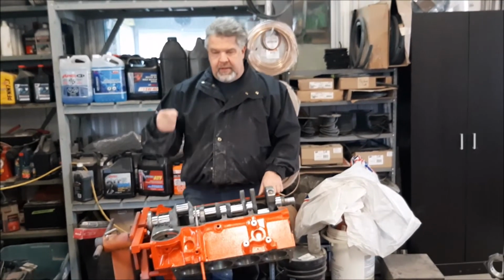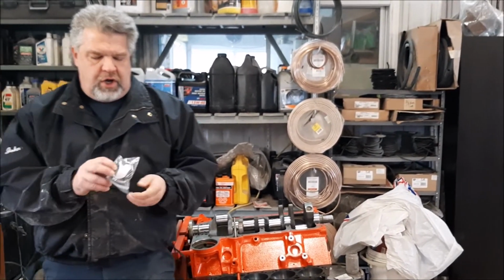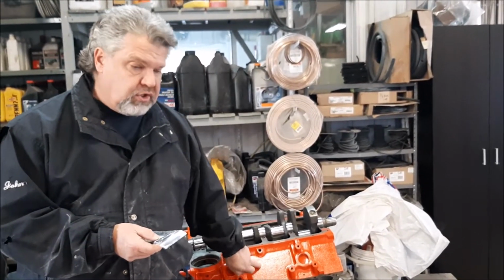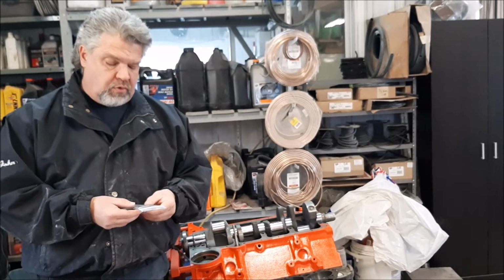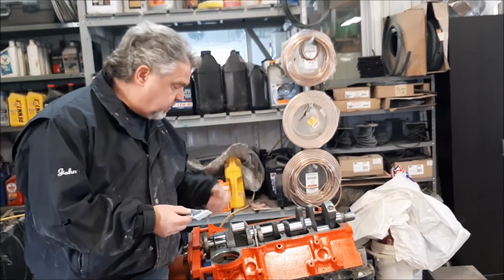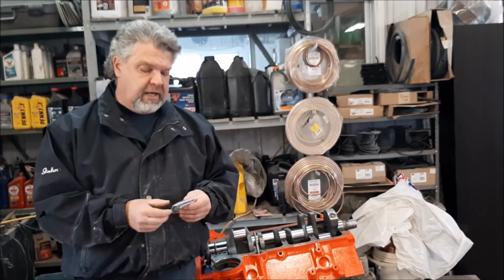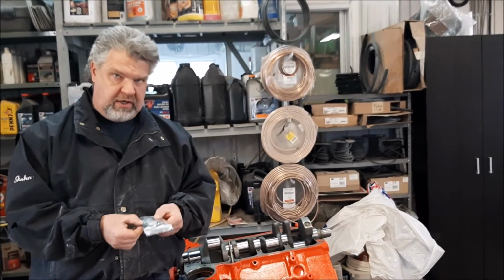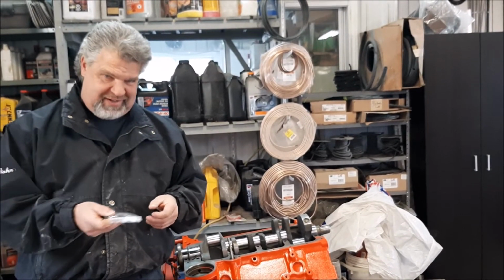So basically, the other thing I mentioned earlier and kind of stopped was the rear main seal. Very often people will say there's an upgraded seal. Traditionally, this engine block, so 56, 57 and 58 Corvette 283 engines, was a rope seal. Most people, when they redo these cars, will put the rope seal in. They're notorious for saturating and causing drips every once in a while. So we're lucky enough, there's a supplier that we were able to locate that makes a specific two-piece upgraded seal for this style of block. Very, very hard to find.